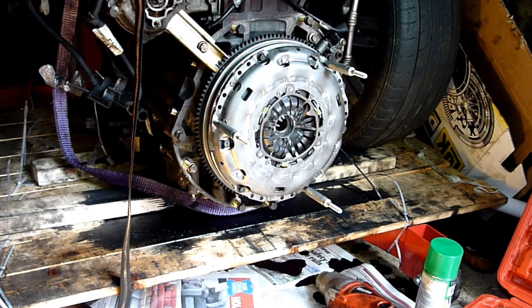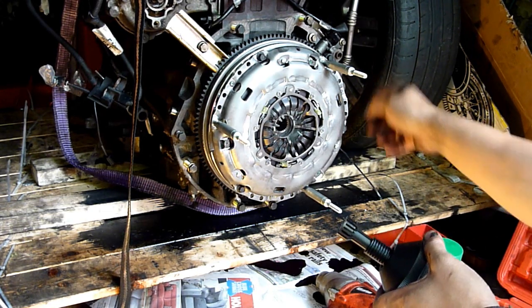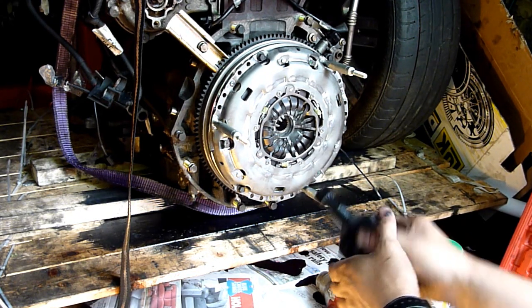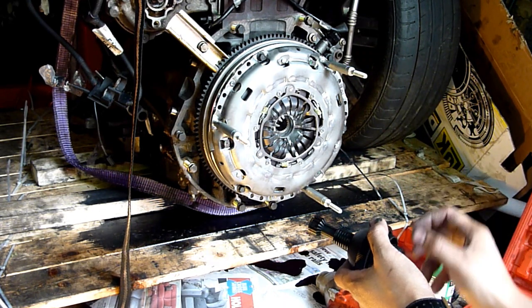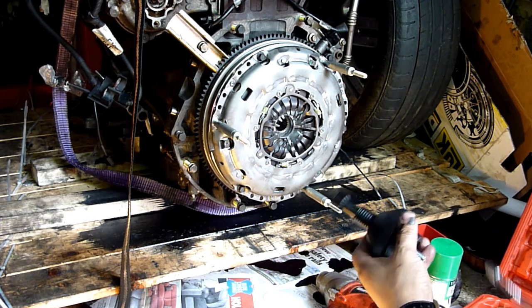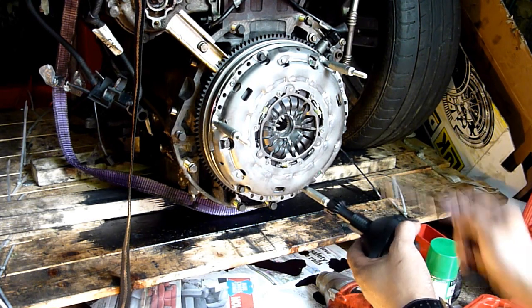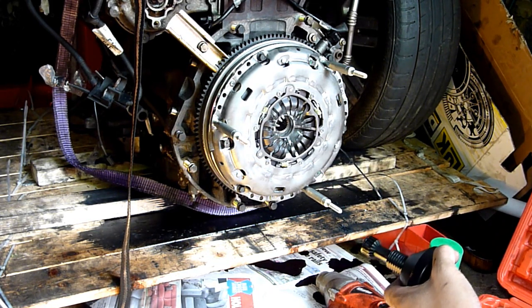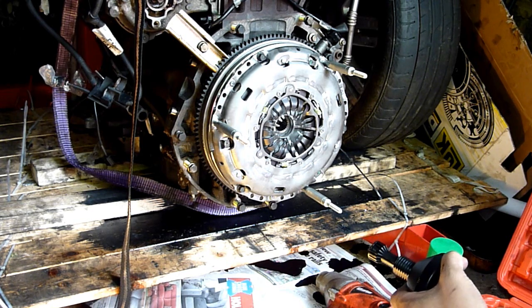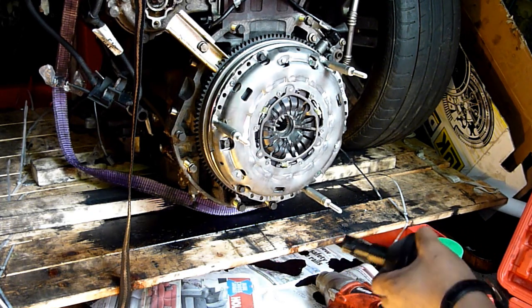It's taken me quite a while to center it. I loosely put the plate in there, three bolts, tightened it with this, held it in place — just loosened, kept one of them slightly tight, and kept moving around by tapping it. Tiny little movement — it's very difficult to get a dead center. I'm looking straight in there, lining up the teeth of the shaft with the inside diameter, which is what really counts. I've kept the bolts in there because I haven't got that pilot bearing in the center.